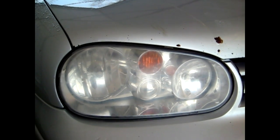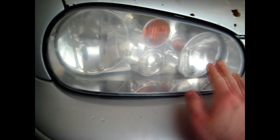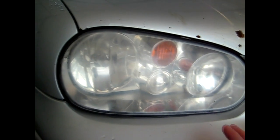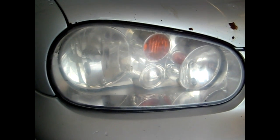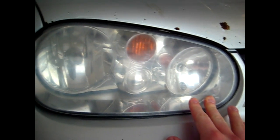Here's the final stage with 2000 grit sandpaper. Now you can see the scratches are actually a lot finer. The higher number you move up on sandpaper, the finer the scratches it produces. As you can see it looks a lot more clear than what we started out with previously.